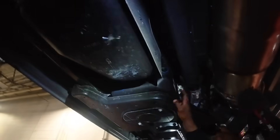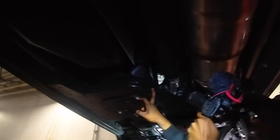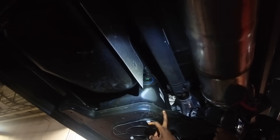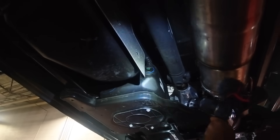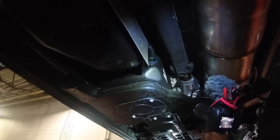There's the chassis-mounted fuel filter for the 2024. When we look at the 2025, both fuel filters are now up on top, mounted to the side of the engine. Also, that's a five-and-a-half gallon DEF tank on the 2024; the 2025 has a seven-and-a-half gallon DEF tank, so you're going to get a lot more range out of the DEF system on the new one.